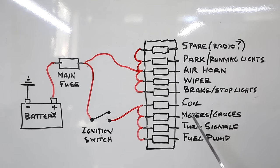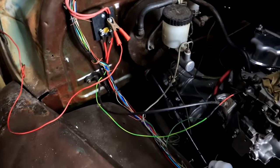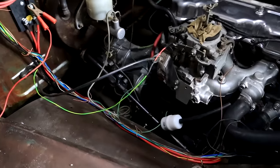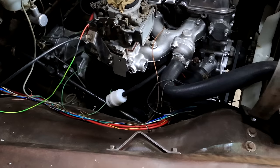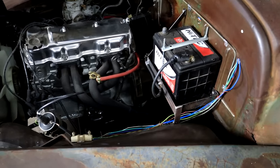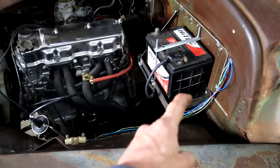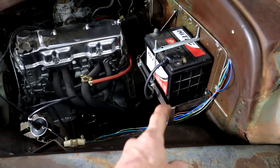I've got nothing on ACC or accessory, like I would with a standard ignition switch. I want to keep it as simple as possible — I've never really been much of a fan of the ACC setting on a switch anyway. More spaghetti coming through the firewall here on the way to the engine, the alternator, the starter, and the headlights. Going to the coil, down to the headlights and the turn signal on the left-hand side.